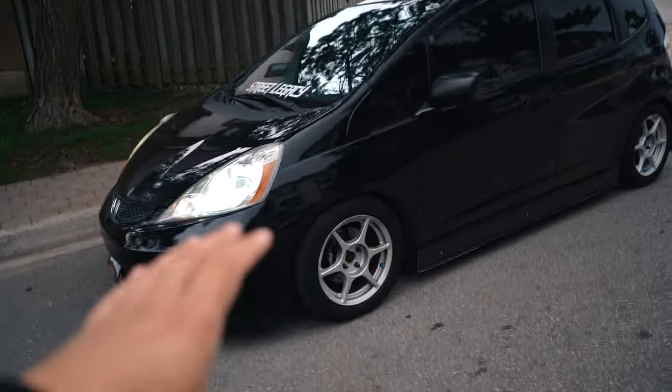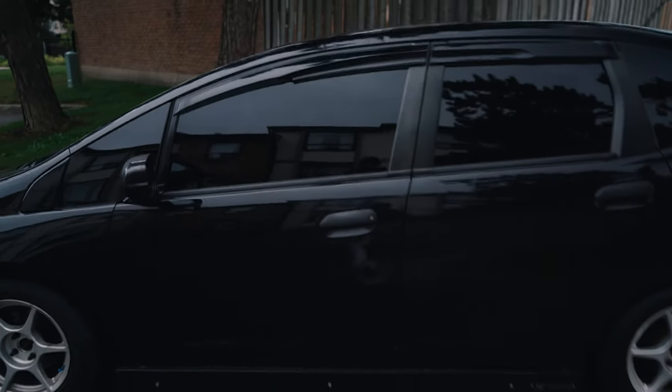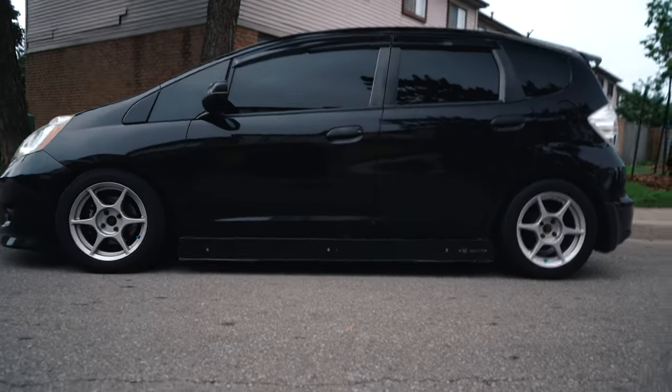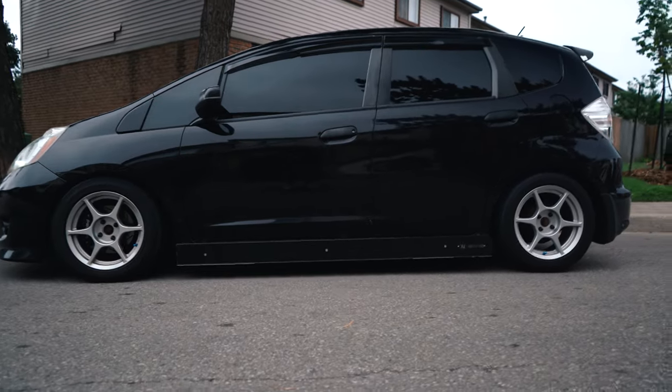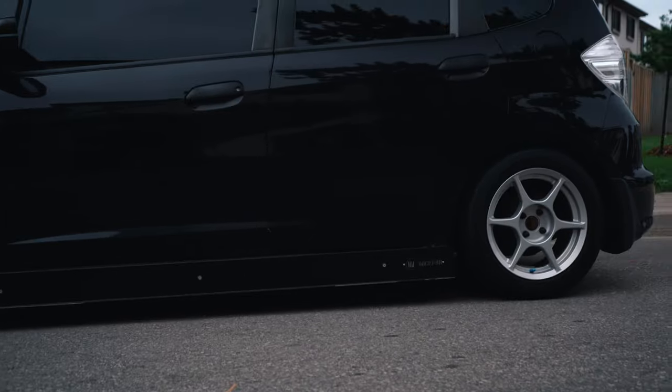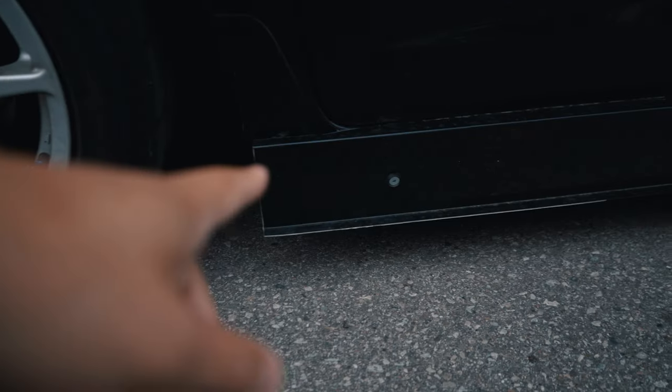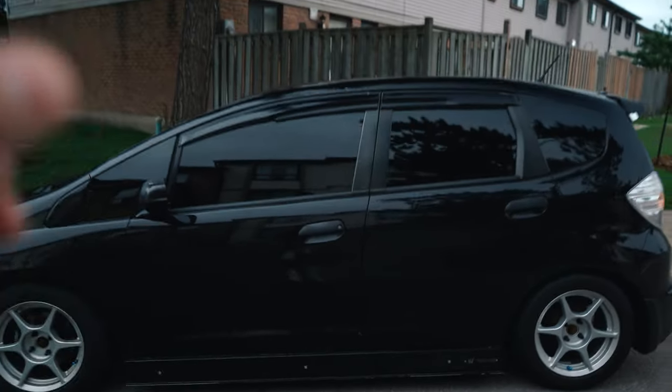So this is a few days — actually a little while after we installed this — and a few things did happen. After going back and checking out some footage, I wanted to clarify how we did this. They are on and they are on sturdy. But what happened is I went tracking and I did lose this side screw. You can see the white part where it was dragging. So what I had to do is get the brackets welded on — we made custom brackets, drilled some holes, and used self-tappers through the rockers. The rockers on the driver's side were a little soft due to our Canadian winters.